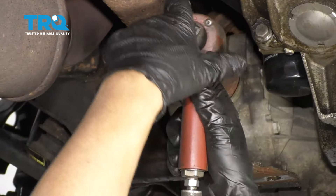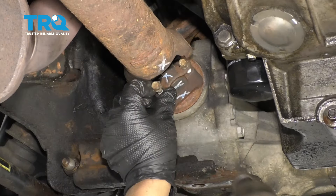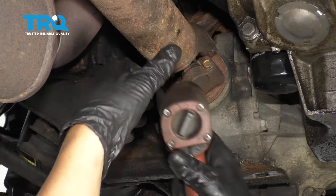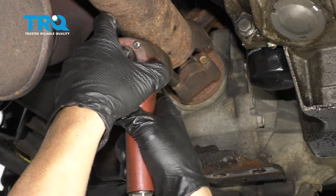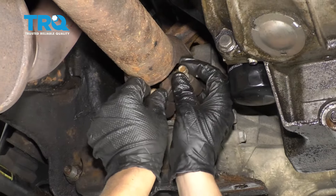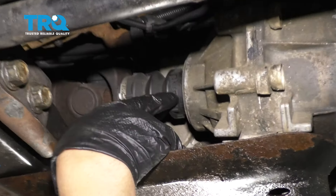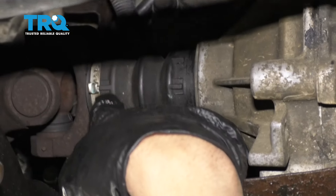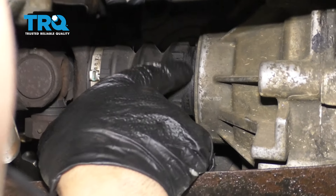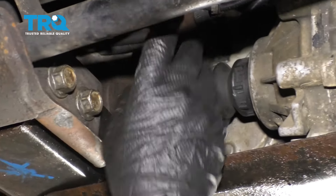I'll use an 11-millimeter socket or you can use a wrench. Take these caps off, just twist them, and get these ones off. Before I slide the driveshaft out, there is a clamp that goes right here — you're gonna want to take that clamp off. If it looks just like this one, you can either cut it off or just try to jam a screwdriver in there and pry it off. When you go to put it back together, you could use a tie wrap or wire tie. This one doesn't have that, so I'm all set.